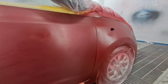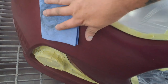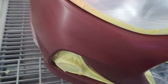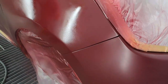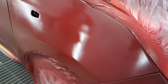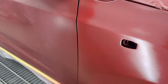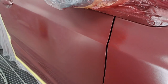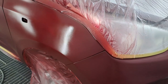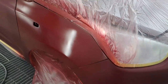Also remember guys, to give yourself flash time on your base — don't let it stand too much, especially on the painting. Use your tack rag. After every coat I wipe off the overspray with my tack rag and then continue. As you can see it came out very nicely, covered quite well. Give it a bit of time to dry and then you can continue. It's very important to cover those marks before you do your complete spray on the door or fender.